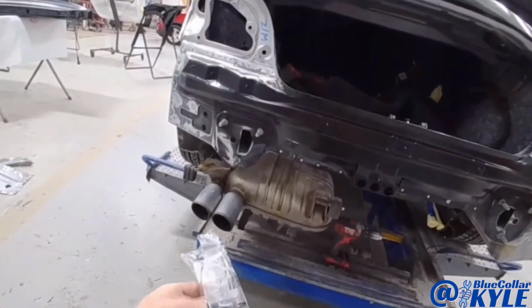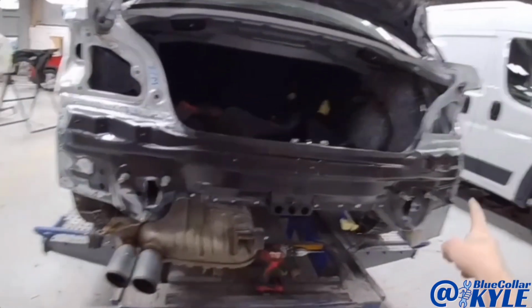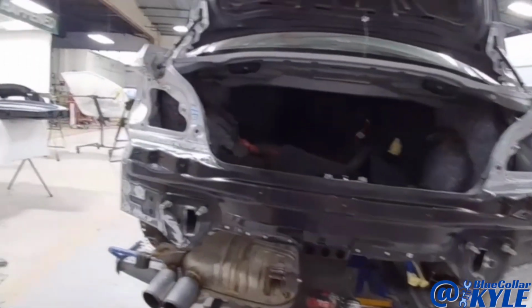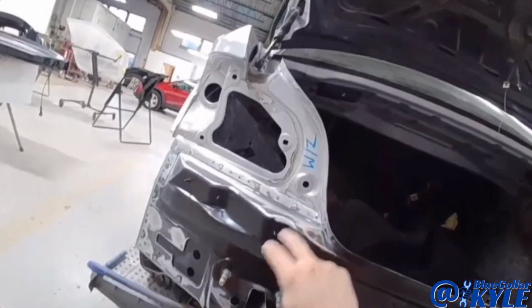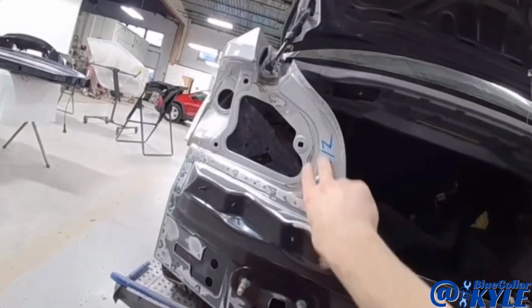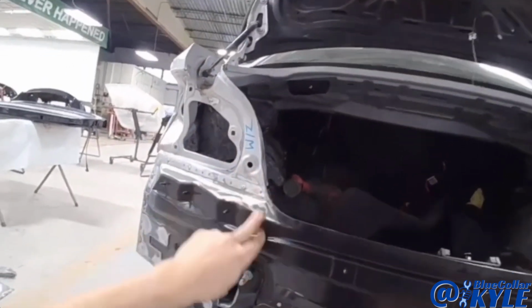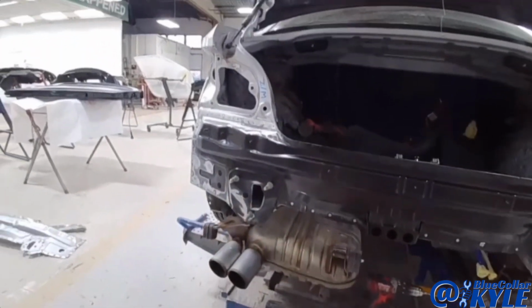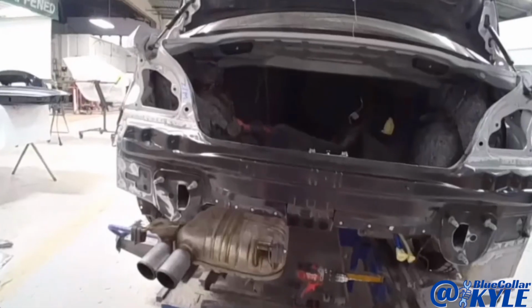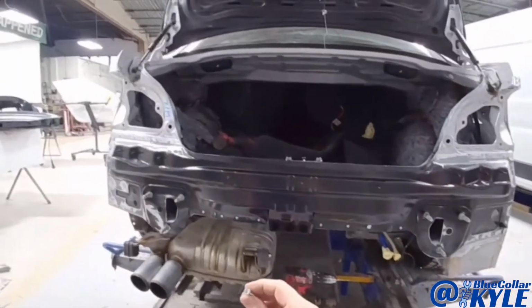Alright, now before I seam seal this, I have these EMC screws that I have to put 9 of them in this rear body panel. And the reason BMW does this is because you gotta have a ground connection between the two panels, and with all the adhesive in there, there's no guarantee that there's a good ground anymore. These rivets aren't necessarily going to connect the metals properly. So, look, they have you put these EMC screws in there to make sure it has that proper connection.